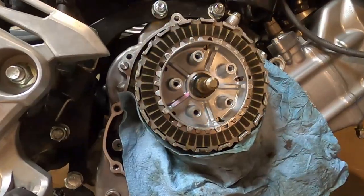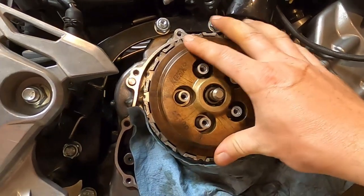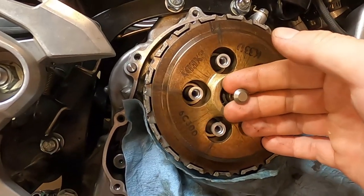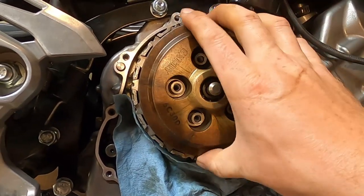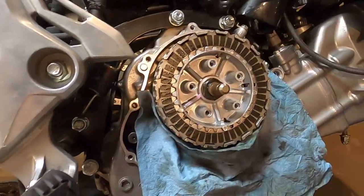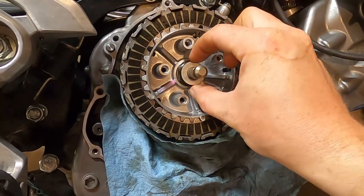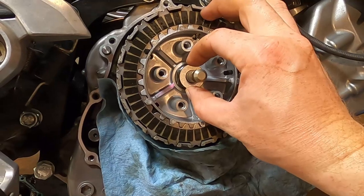So this is our clutch actuator lever. With the 6-disc clutch, this plate, the pressure, I'm assuming this would be the equivalent of a pressure plate, is out more. So you get all this extra play in this actuator rod. Now there is a ball bearing inside this plate, as you can see. It's a wet clutch, all right? And that's important because I found a washer that I had that fits over that rod as close as I can get to fit, okay?